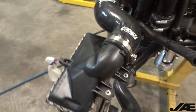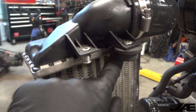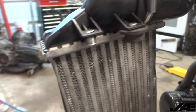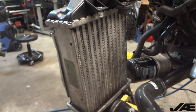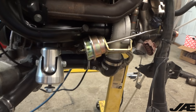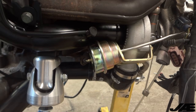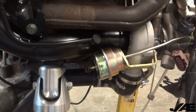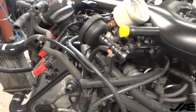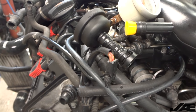A major leak that I did find was on the intercooler tank in the crimped area - there was a fairly decent sized leak. Unfortunately we are using the stock intercoolers just for now; hopefully we will upgrade those so we'll just leave that alone. The o-rings did completely fix the inlet problem - I'm glad they did include that second set, though I'm not sure what the intent is with the thinner set. I did also feel some air bypassing through the PCV, so that's probably just a worn valve, but again not the end of the world.